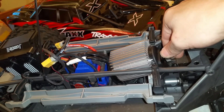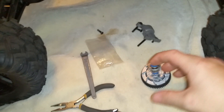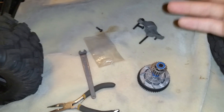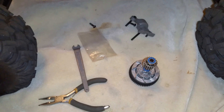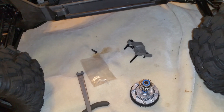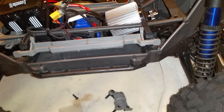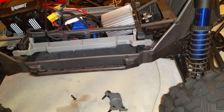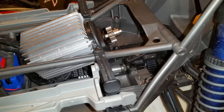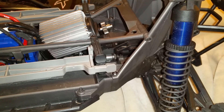That's basically what happens when you put more teeth on your pinion gear and fewer on your spur — you're making the motor have to work harder, having to work overtime. People doing 14S setups — I know this thing is built like a beast, especially with spline shafts, you don't normally see an RC vehicle with spline shafts. But that secondary spur gear down in there is plastic, so you could strip that out.